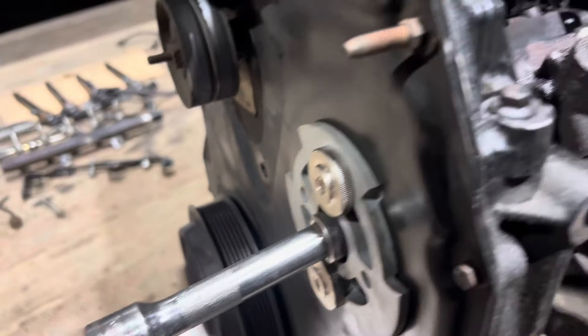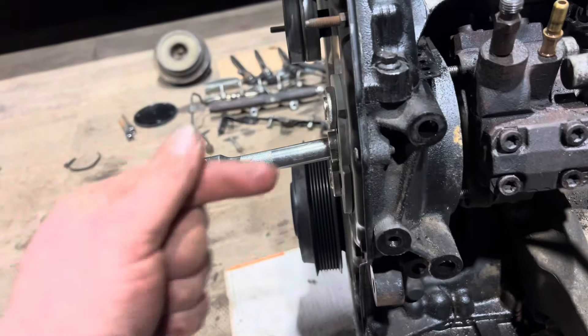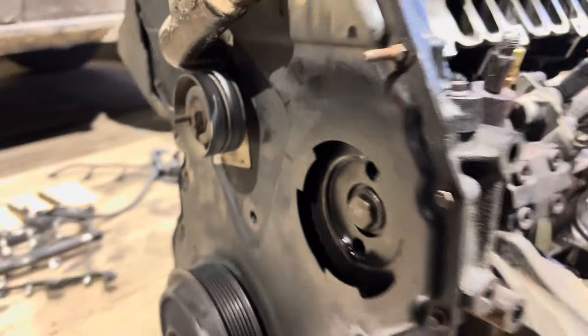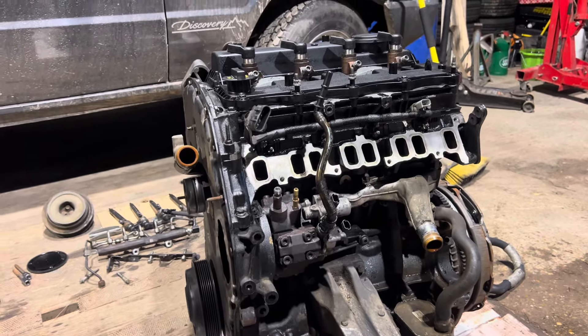This one is going through here slowly — doing up that 21mm — and I've got the three 10mm bolts in. I'll do a few turns that way and a few turns that way, and that's slowly compressing the shaft and the sprocket. There we go — job complete, bolted in, just got to put the cover back on. That is how you use that crappy Laser tool.